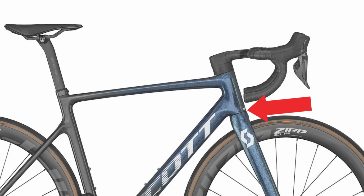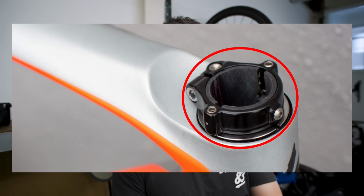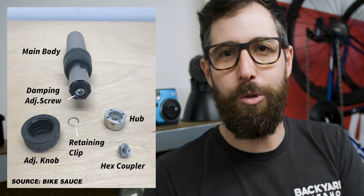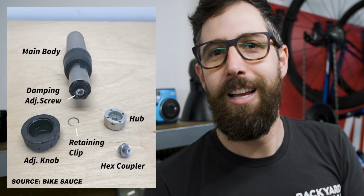Most manufacturers, well, I say 99% of manufacturers, use a system of lower headset bearing, upper headset bearing, expander bung or a star nut, compress it all together. Your headset works. Yes, I've got different shapes and size bearings, but that's a completely different thing that annoys me. But then you get companies like Specialized with their Future Shock, I think it's called, which is a suspension headset that goes into your bike. Loads of tiny little fiddly bits that you need to work out, 4 different bolts to adjust it. Nightmare. You break it, local bike shop most likely won't have stock of it unless they're a Specialized dealer. And even if they did, you're looking at about £200 to have it fixed. Why? Just stick with what's worked for years and years and years.